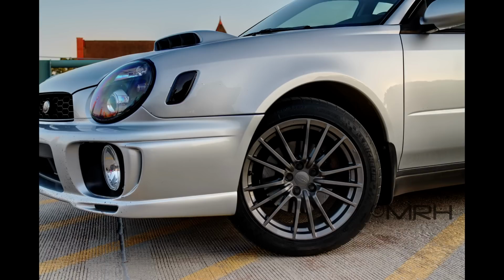Few people try to change their power steering fluid on their Subaru WRXs and so forth on YouTube, and they do the turkey baster method where you take a turkey baster and you suck all the fluid out of the reservoir, put fresh in, go drive it around the block, come back, suck it out, put fresh in, and repeat until they have clean fluid in the reservoir.